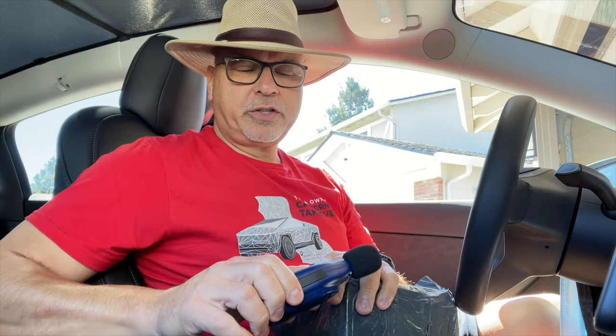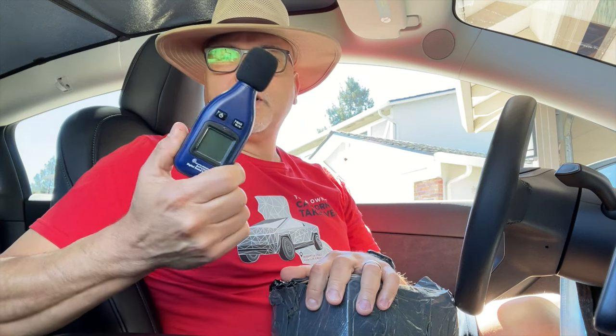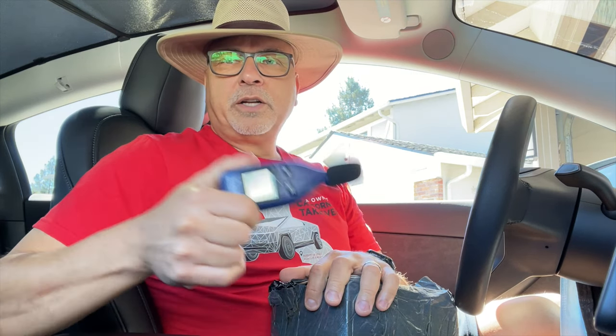It's basically a bunch of rubber gaskets that go around the doors and the hatch of the vehicle. I'll be installing that and we'll be doing a test. I have an official sound meter here, and I'm going to take a drive a few different times on a particular stretch of highway, record the max rating of the sound, then do the install, run that same route a few times, and then compare the averages.